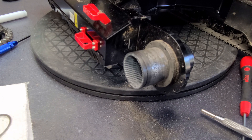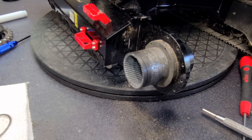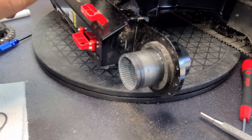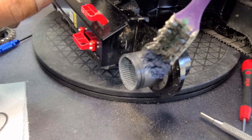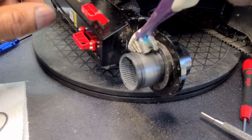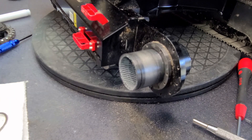I looked at the very first gear which I replaced before — it's not chewed up yet, but I was hearing a lot of grinding in there. So I definitely need to clean this up, clean inside, hit it with white lithium grease, clean all the gears, throw it back together and see what happens so it doesn't make that grinding sound. Good news is I don't find anything binding, and the scaly stuff comes off quite easily with a greasy toothbrush. I'll lube it up and put it back together and check the function.